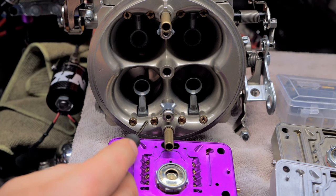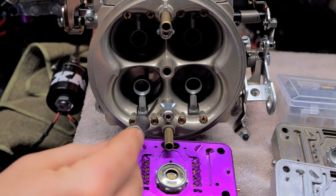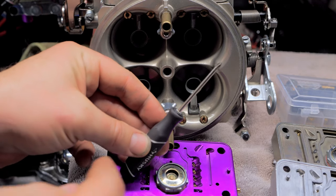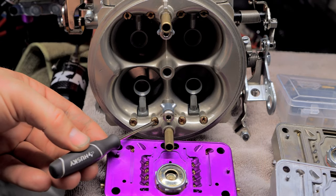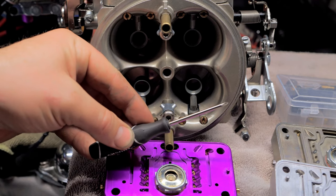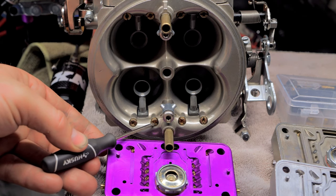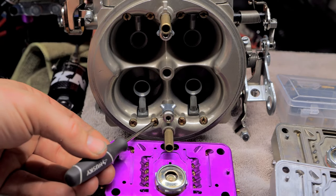This is when you're all the way open and the signal's super strong right here, and you're not pulling that much right here. The signal is now moved to this area of the carburetor and your boosters. So what happens is, the smaller that is, it will move the fuel curve kind of like this. So your low end has less fuel and the top end has more fuel when this guy is a little bit smaller. And if it's bigger, it'll kind of move it like this. So if you get everything set up right and you watch at the very, very end of your run, it starts to go a little bit lean, then you know you need to go a little bit smaller on this guy right here, and vice versa. So if it goes fat, you need to go slightly bigger on this.